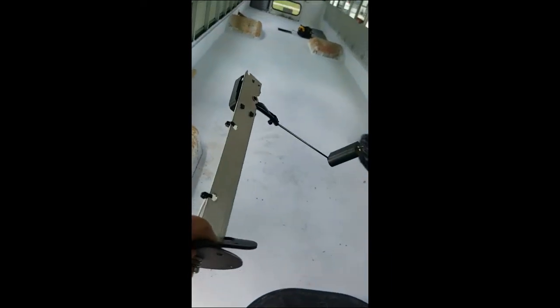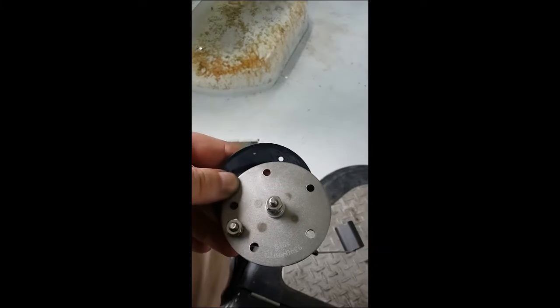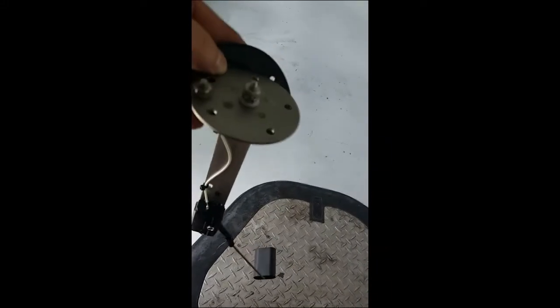But for today, let's grab the probe. Okay, that is the probe. Two wires, gasket, couple nuts or bolts, and just a simple float valve indicator. Alright, as you see, there it is again. Same thing, 2 nuts, 2 wires, 5 bolts. So we'll remove those 5 bolts, remove the 2 nuts, remove the wires from the 2 nuts, pull the whole thing out and replace it.